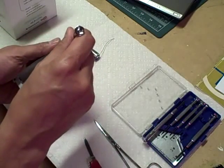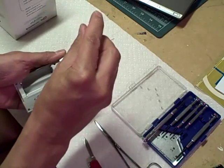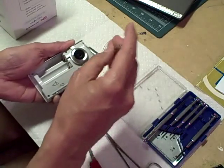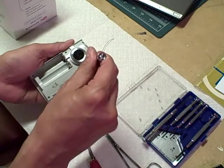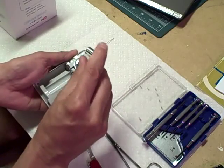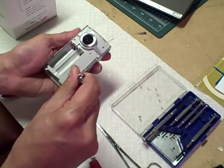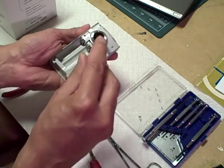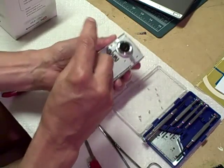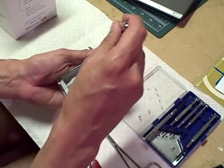Then, just a small screwdriver — take these screws off the front. They come off fairly easily. You have to get that top cover off to have access to those other two screws; otherwise you won't be able to take the cover off. It's fairly typical to have a couple of screws that aren't as obvious as the other ones. I've got most of these done here, and I think I need to unscrew this one just a little bit more.